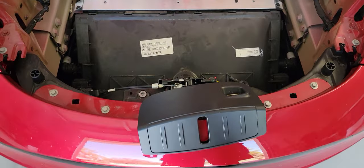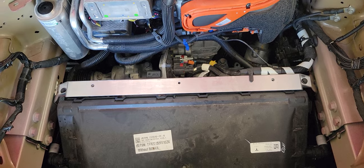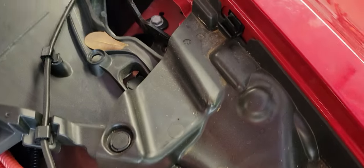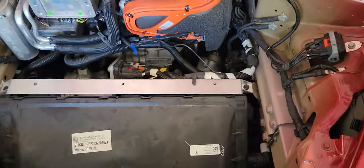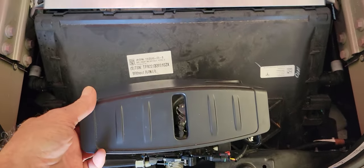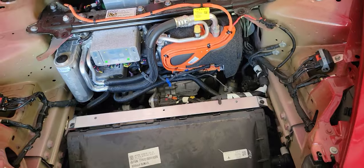Now I'm going to put the car back together. I take this piece, put it over, snake this through, set it back in, and put the seven bolts back in. Then put the piece that goes here, and then the whole piece — these just snap back in. The big piece snaps in at the corners: there's a snap here, a snap here, and a snap over there. The rest is held in by the 10-millimeter bolts — just use a socket wrench. Snake the connector through, press it in, and it snaps in as well. Then you're back in business.